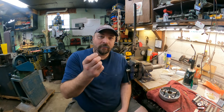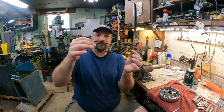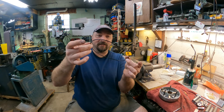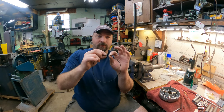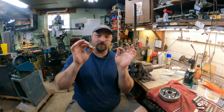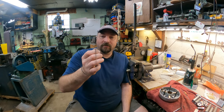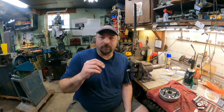So I went ahead and took it apart, assuming that this O-ring was bad. And you look at this O-ring, I can't find anything really wrong with it. There is a spot up in here that got pinched a little bit, but I really don't think it was leaking there. These are a bit of a pain to get on and off. So I put this back on, put everything back together, and fired it up without the belt on it, so it would just stay there. And it was just spraying oil like crazy.